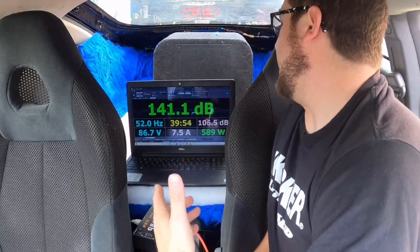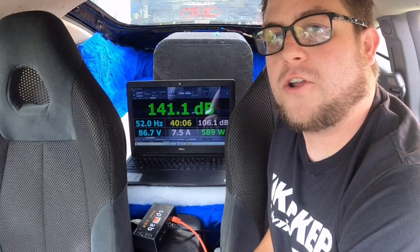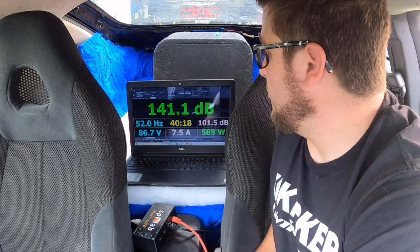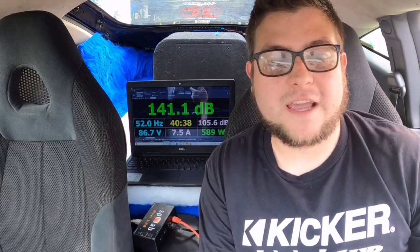If this floor didn't extend past the B pillar as much as it does, and you threw this into competition lanes, you'd be pretty close to a modified street class. If it fit in street one — no raised floor, sub back below the back seat line — you'd be doing a 141 at the dash, at least 140 at the headrest, which is not bad for a street one class with a prefab enclosure as a beginner. If you like what you saw, make sure you tune in. I enjoy doing this and I'm happy to help. Smash a thumbs up, comment below, and I'll see you guys next time. Thank you for watching.